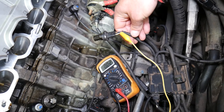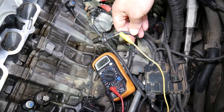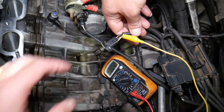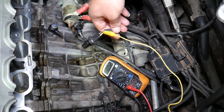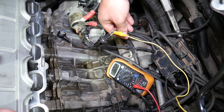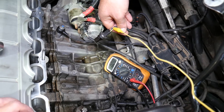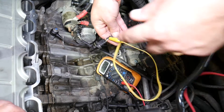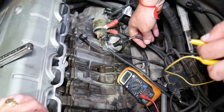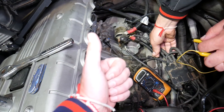This is a good working sensor. You can also test it without the ignition on, but you will need to supply it with 12 volts and a ground wire externally. You can see it's doable either way. That's how you test the crankshaft position sensor on a BMW 5 Series. Thank you for watching — please subscribe and see you next time.